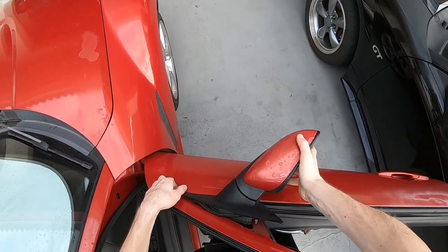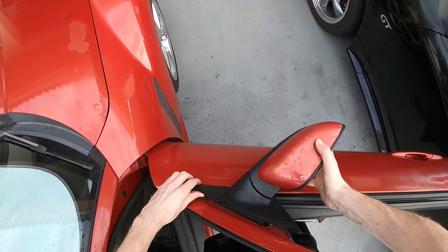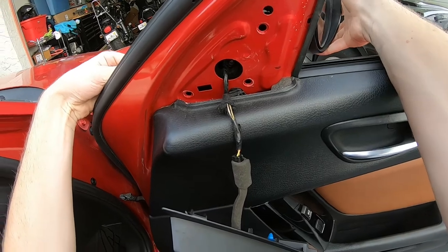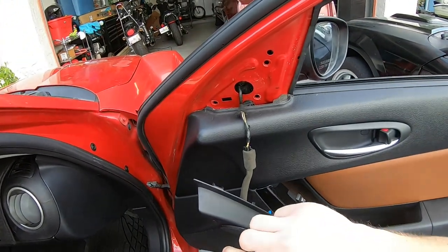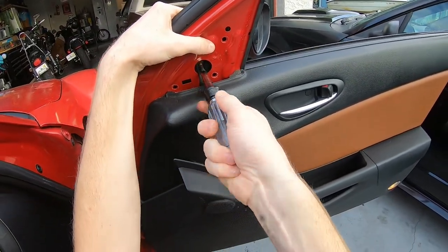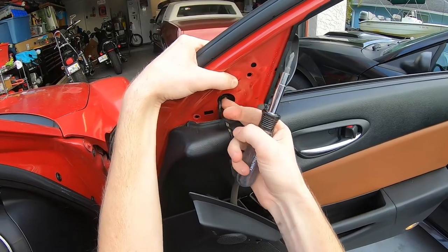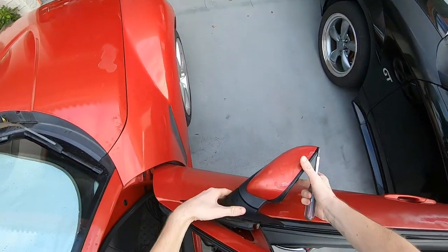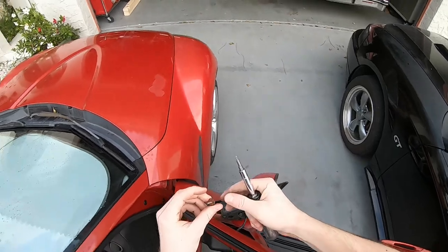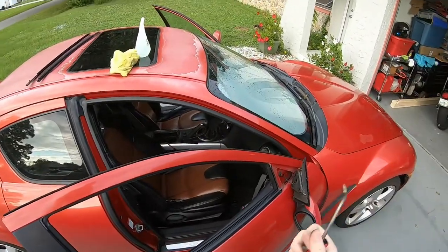That side slipped out. There's a little gasket here — we're going to leave that. We do need to take out that one screw, which is just holding the wire taut, so I'll unscrew it and snake the wire around it just like so. Now we can just leave the power mirror hanging. I'll put the screw down with the rest of them — and from here we are almost done already.